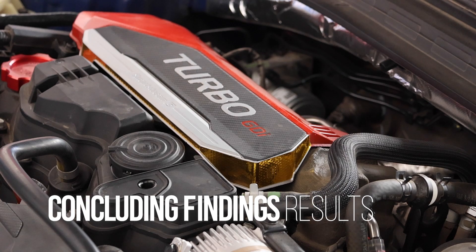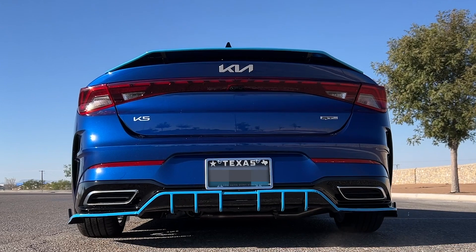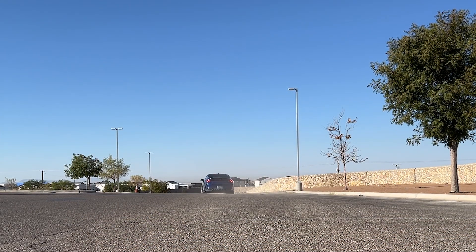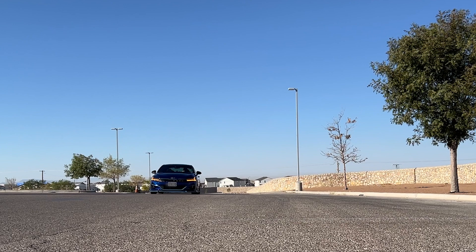You guys just watched everything live. One thing we know about science — it's not science unless it can be repeated. What you see here is that if you tighten down to 17 foot-pounds, these HKS plugs will not loosen up. If you tighten without a torque wrench and you're not measuring torque, they may not hold. But as you saw, it works if you use 17 pounds as directed on the side of the box. Use 17 pounds if you don't want it to back out — if you use less, it will back out like my friend said.